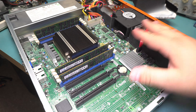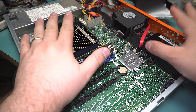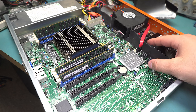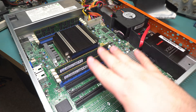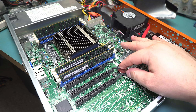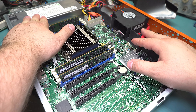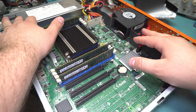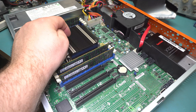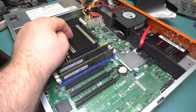This whole server is essentially just a case for my component upgrades. I really don't care about the hardware in terms of the chassis — it was really just to get all these parts. I specifically bought it because the listing was essentially listing all these components so that people would be buying it as components. The power supply is a standard 1U power supply, only about 260 watts, which seems a little low. I think this is a 130-watt TDP CPU, so it's kind of pushing it — although under load running Cinebench it only hit around 170 watts or so.